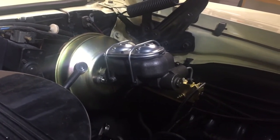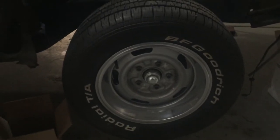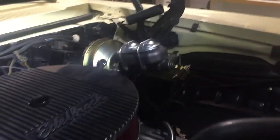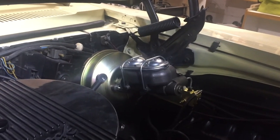If you get this kit, it does have really good instructions. I got this kit from Summit Racing; it's for a 14 inch wheel. There is the wheel on now, and I went through and bled all the brakes — front and rear. You can hear it's got just a little bit of drag, just the way it should. While I was bleeding the brakes, I went ahead and completely cleaned out all the brake fluid in the system. I bled it until it was all clean, so this system is all ready to go.